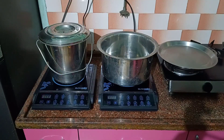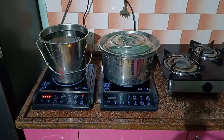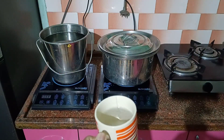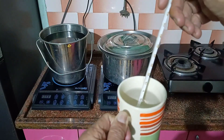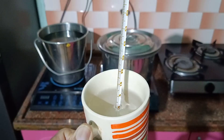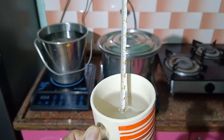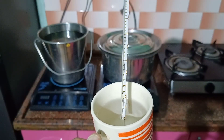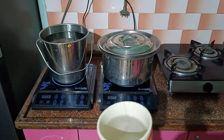Now let us check the final temperature after the 10 minute period on 1600 Watt. Look, the fan has stopped — it runs for up to one minute after the heater stops. So don't shut the induction or power supply — wait one or two minutes more for the safety of the induction heater mechanism inside. That is another tip. Also, put the bucket or the pot exactly in the center of the circle provided on the induction top — that is another tip. Now let us check the temperature with the mercury thermometer. See, it is around 38 to 39 degrees centigrade. So we will consider it as 39 degrees centigrade. Final reading is 39 degrees centigrade — from 25 to 39, that is a 14 degree centigrade rise we have got.